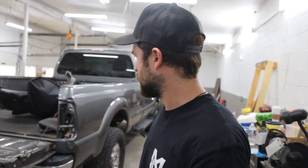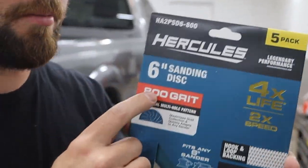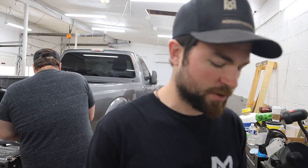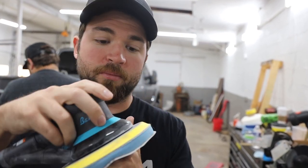JB's assembling the truck. Now what we did was we tried to keep this super cheap and DIY, but still try to get a professional result. First off, we used all Harbor Freight sandpaper — all this Hercules stuff. We use 600 and 800 the most, just to scuff the entire panel. We were using two main sanders: they have a $45 one and then one that's like a hundred dollars. We blew out the $45 one, so we just got the better one, and this one works a lot better.